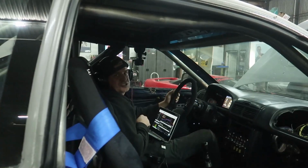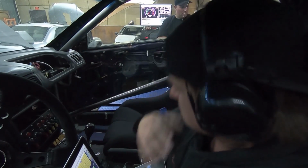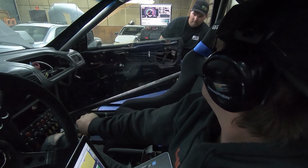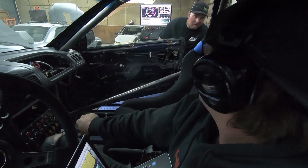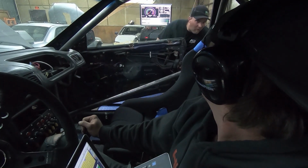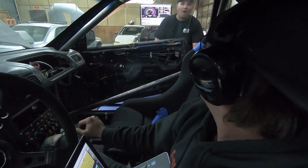Super surgy. I'll pull the graph up so you can see it. It looks so strange, man. Super unpredictable. You may have to go to a 3-port unless I can put this 4-port on a bench. You might need a 3-port until I can figure this out on a bench and get the PIDs right.